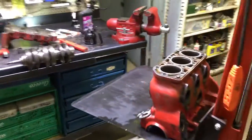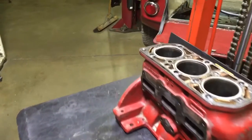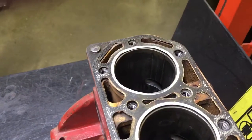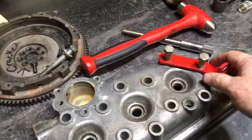I'm currently the caretaker of this unit, and shortly after I picked it up, it started to leak water into the rear cylinder. You can see the head gasket's got some intrusion on it. And I think what can cause this rear gasket to go bad — more than the rest of them, though they had trouble with all of them anyway — is this bracket.